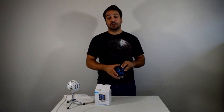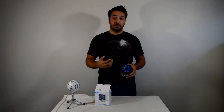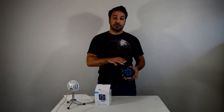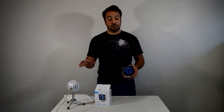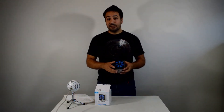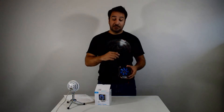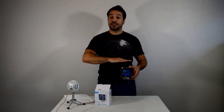We're going to evaluate this compared to other tower style coolers, just so that you know what type of performance you're getting. The primary directed market for this cooler is if you have a build that doesn't fit other tower style coolers — a lower build. It is quite low at 112 millimeters high, which means it sits lower than pretty much a lot of graphics cards on the market.